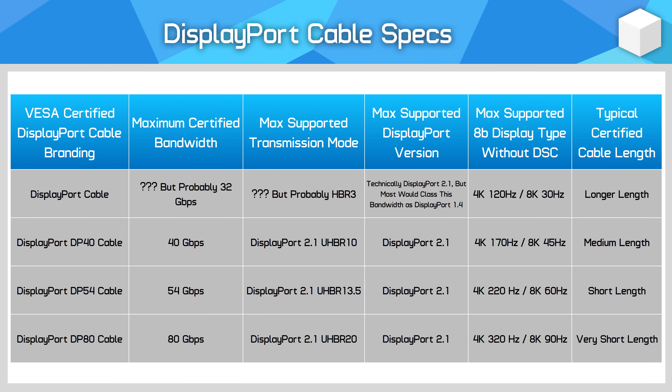The reason behind the inclusion of such a short DisplayPort cable back then was bandwidth requirements and VESA certification. DisplayPort 2.1 UHBR20 uses 80 gigabits per second of bandwidth, which means you need a cable capable of transmitting 80 gigabits per second. At the time, officially VESA certified DP80 cables topped out at just 1.2 meters long — a mere 20 centimeters longer than the cable Gigabyte supplied.